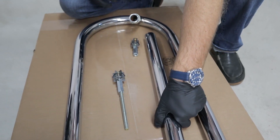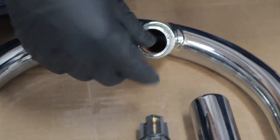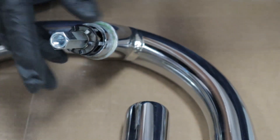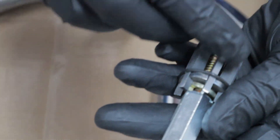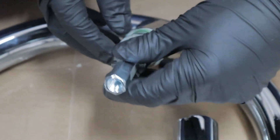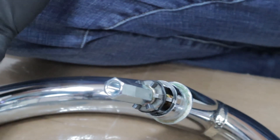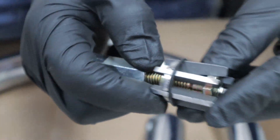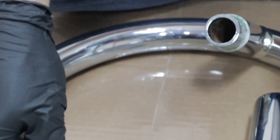You also want to do the same thing in this area right here. Some of these sometimes have a little bit of a lip that needs to be ground off for this to fit smoothly. You might have to take a little bit off of each one of these until it freely slips inside — you can't take too much. The way the mechanism works is as it pulls down on the bolt, it pulls out and grips, but you need enough clearance to get it to fit down there easily.